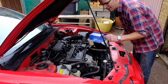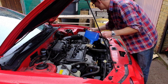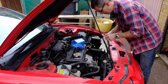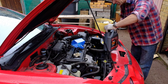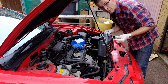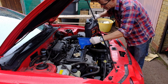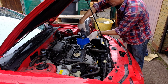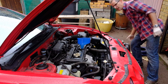Now we can focus on the top of the car again. I picked up this oil pouring funnel mega cheap years ago in Halfords — it saves me learning how to pour oil properly, because even if you think you're doing it right, sometimes you end up with an oily engine. The motor factors all say this car takes 5W40, but the forums and owner's club say it takes 10W40. I'm going to go with the owner's club — they know a fair bit about this car. Apparently it takes about three litres. That should be three litres — let's give it five minutes to settle.